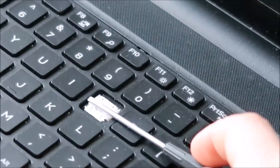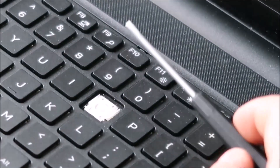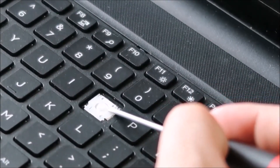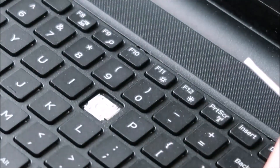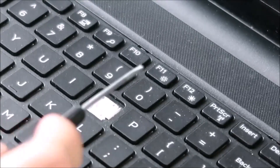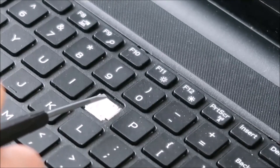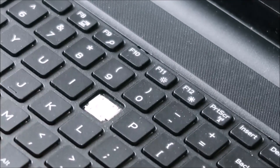As you can see here, my screwdriver is holding down the retainer clip — this white portion. Sometimes they're also black. This is the retainer clip that holds that down, and it's very thin plastic. Oftentimes, if you peel that top part off without holding this down, you'll break it. So it's made up of two parts that are interconnected to each other. That allows for that accordion motion as it comes up. You also have this rubber bouncy component in the middle that's held on by glue. Be very careful not to rip that up — they're very hard to get back down after.